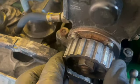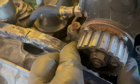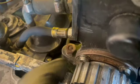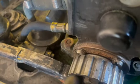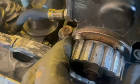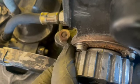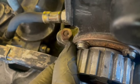So on the pump, there are real small timing marks. And I was going to show you this as well. Again, the only reason I'm doing this is because I couldn't find it on the internet. If it is on the internet, someone can alert us and put a link. Okay, everyone sees the mark in the brown casting piece right here, the flat one up top. Well, what we have to do is put it with the one that's on the cog right here. Now the pump is timed with the engine.